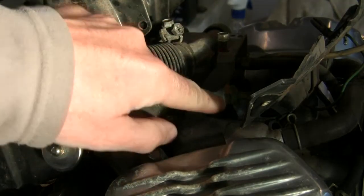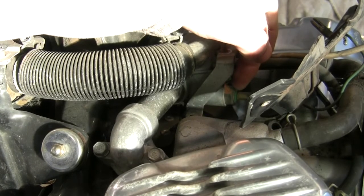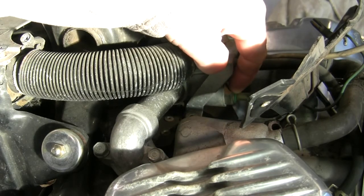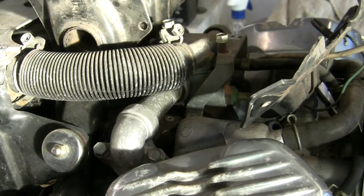One other thing I want to point out: the temperature sending unit is on the bottom side of this thermostat housing. That can be removed and tested in a similar manner to the thermostat. On torquing those bolts: the torque specification is not given in the service manual for the thermostat housing or any of the bolts holding the bracket or the air dam shroud. The answer is snug — they are 6mm bolts, so somewhere around 4 to 7 foot-pounds.